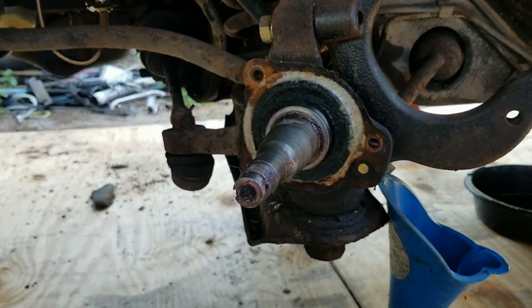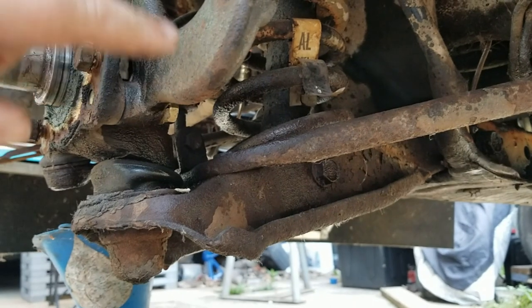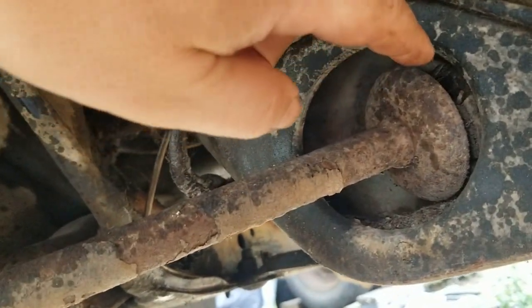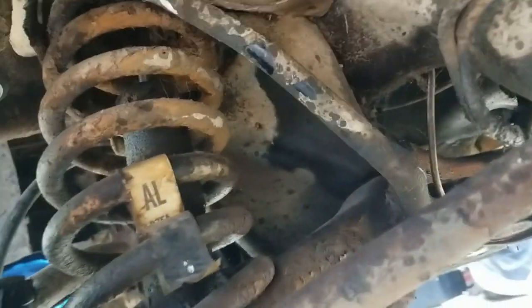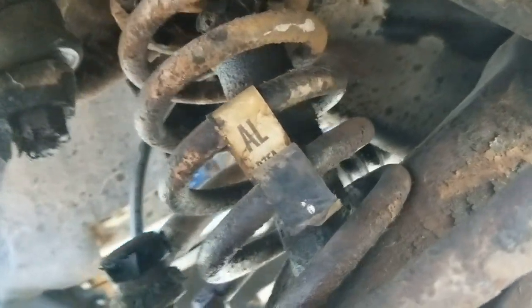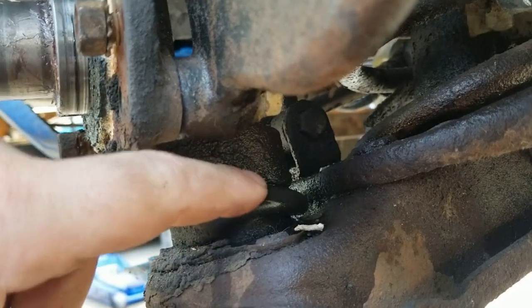Better go back to my book. Part of the reason to do the whole suspension — see this strut and the rubber? That is like mostly gone. Same with the sway bar rubber, that's pretty much gone. Up here it's pretty much gone too. That rubber is surprisingly good — must have been replaced.